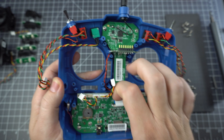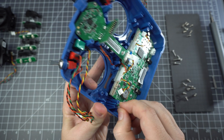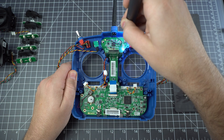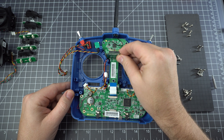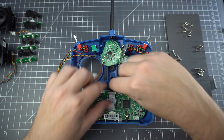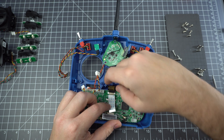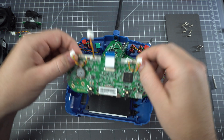Now let's remove the main board. First we need to unplug the RF board and remove this haptic motor. There's a good number of screws here. The RF board needs to be unscrewed because it overlaps the main board just slightly, so just set that slightly ajar. Under that we've got the ribbon cable to the display — carefully remove that — and then you should just be able to dislodge the main board.